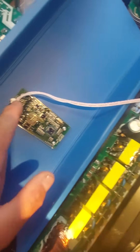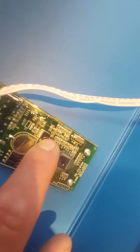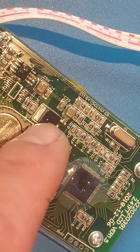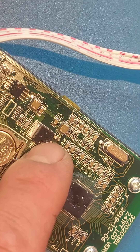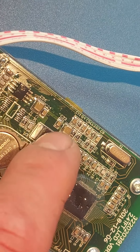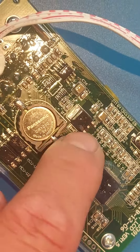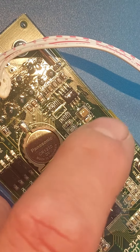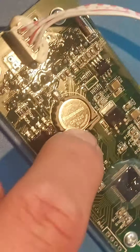Through this ribbon tape to the screen control board — and this transistor here controls the cooling fans. If the fans are working permanently, that means this transistor is shorted and needs to be replaced.